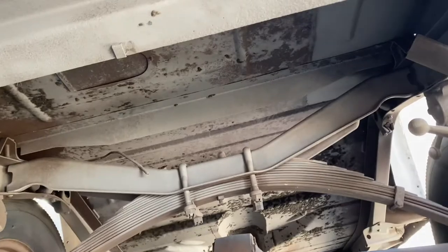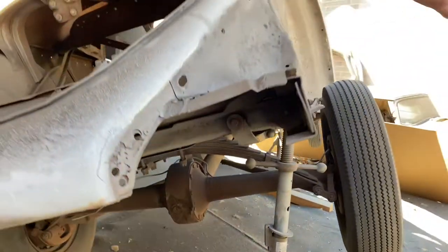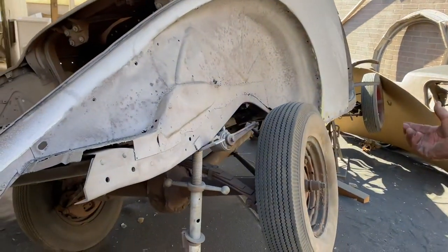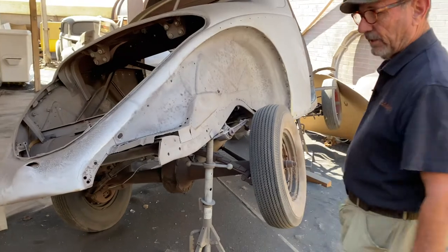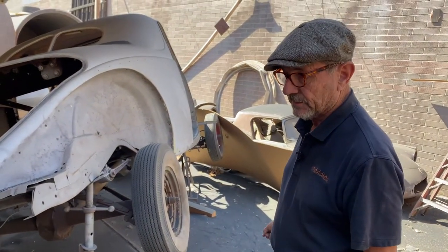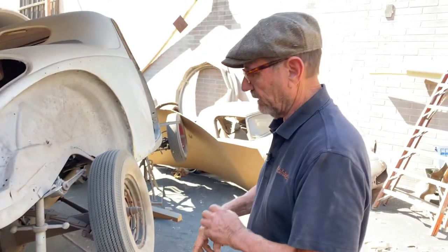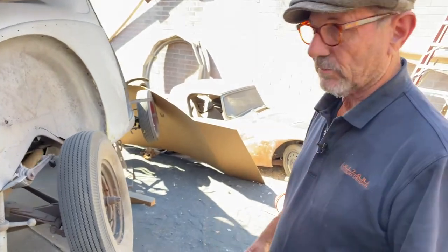If you're concerned about safety, you could use barrels full of water on both ends so that the car, under no circumstances, could actually fall on you. Fill the barrels with water so they're heavy — just an old 16-gallon or 50-gallon barrel with water. Put it under the frame such that no matter what. And of course, you want to check it — take the jack out from under it to make certain it's safe and resting on that safely. Job one is don't put your life in jeopardy. Keep it safe. No car is worth that.